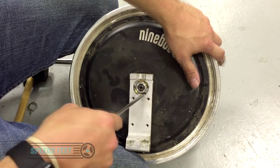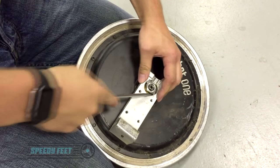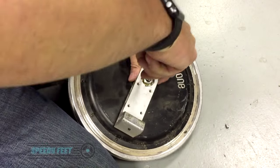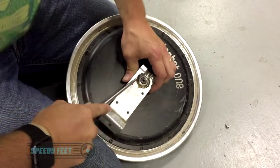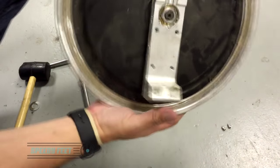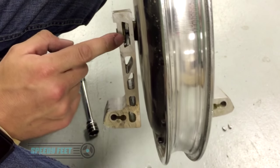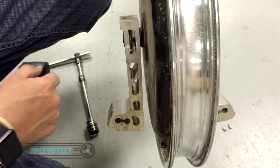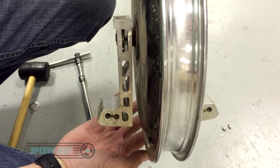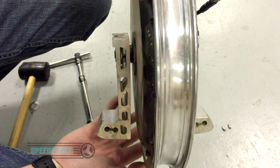It's very difficult to do one-handed. Get the screwdriver and put it under the lead lug, levering it out — same both sides — and just work at it until you get it out. You can easily mark up the aluminium here but don't worry about it too much. Now you're free to undo that centre nut. Take note of these plates here — they're two separate plates. You can just see the base of the nut there; it's sat on a washer and pushing down on a taper. As you tighten that up it clamps down and compresses, making it even more secure. That's the position of those plates — if you forget how to put them back, that's what they should look like.